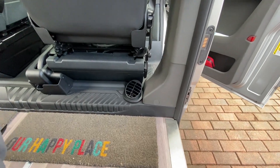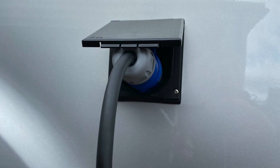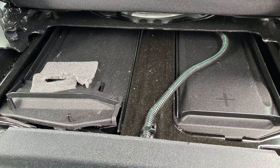If this is not followed, deep discharge may result and can damage your battery. In the event of a deep discharge below 10.5 volts, the heating and cooling systems will be switched off and will not work. If the battery drops to a 7 or 8 volt level, the battery charger will not start when the 230 volt attachment is made — instead, you'd have to start the engine to bring up the auxiliary battery voltage, and then connect the 230 volt power for the battery charger to kick in. Only replace the batteries with approved AGM batteries.